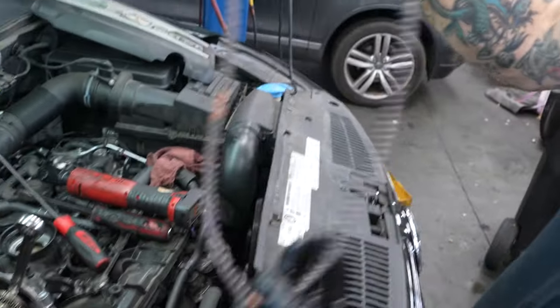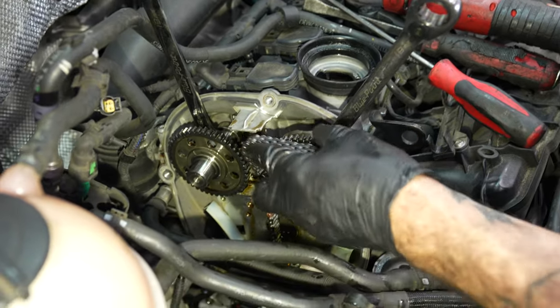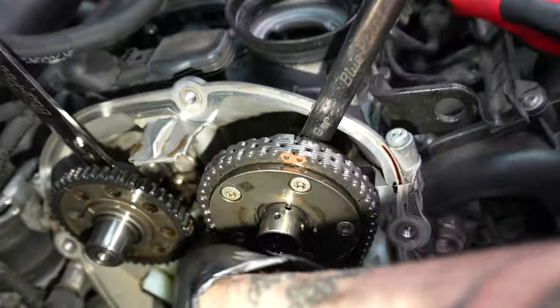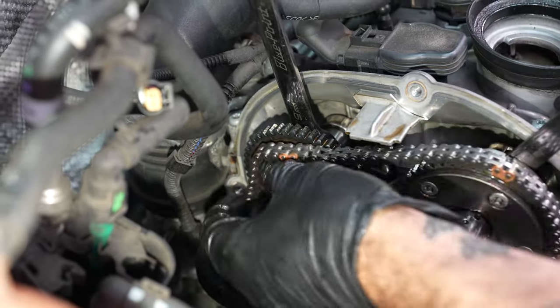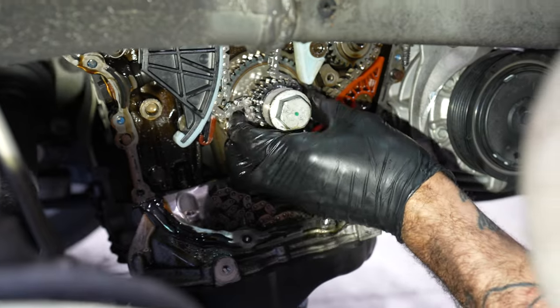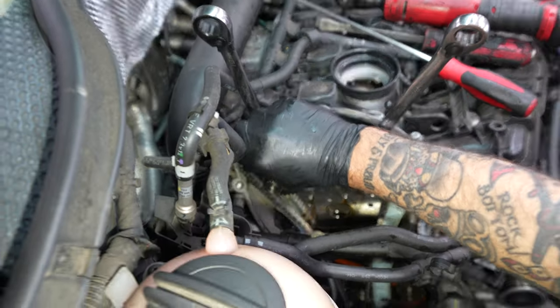Is it labeled or do you just know? You can't go any other way. Drop this guy down in here. We'll put the intake on the intake mark right there. Take this guy, sling him up there. This triangle right here — that corresponds with that mark there. Tuck it up so it kind of holds itself like that. Give it a pinch, go up here, pull the tension to the back.